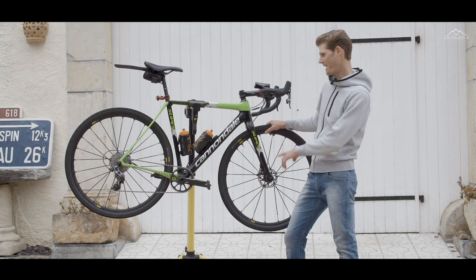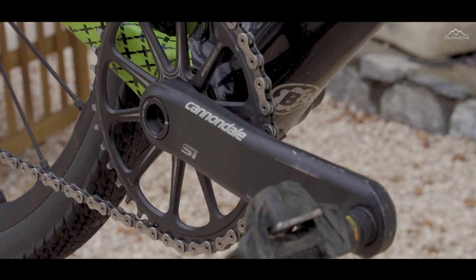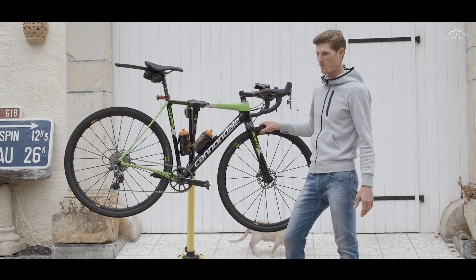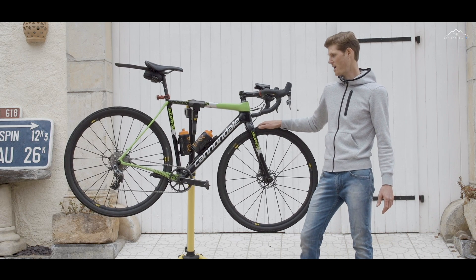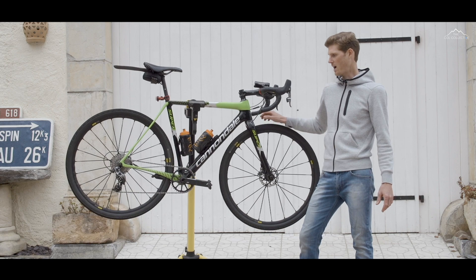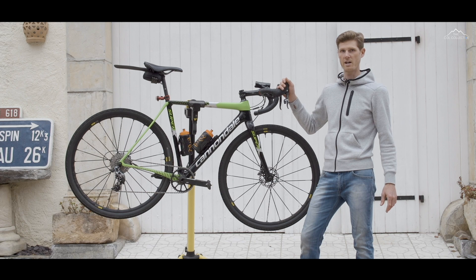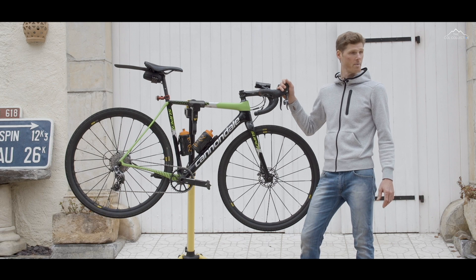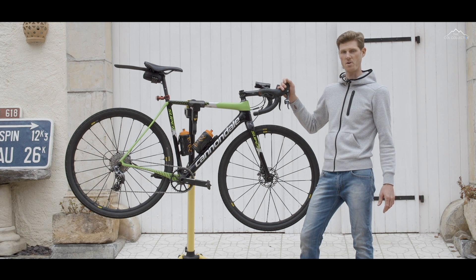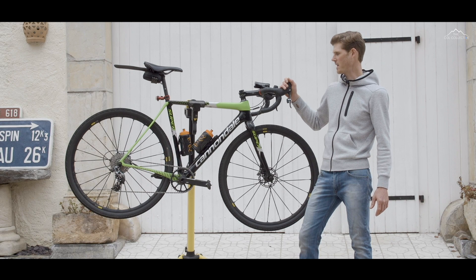You want to get your ride time in. You'll see that I've got a single ring on the front — no front derailleur. It's a 40 tooth chainring and I've got a 32 on the back. Gearing wise, on the downhills I'm spinning a bit more, which actually keeps you warm. On the uphills I'm probably grinding a bit more, which gives me a chance to work on my pedalling technique — high cadence and also some low cadence seated drills. Without a front derailleur, there's a little bit less for mud to get clogged up, and one less moving part to go wrong. It keeps it nice and clean, easy to spray off and maintain.